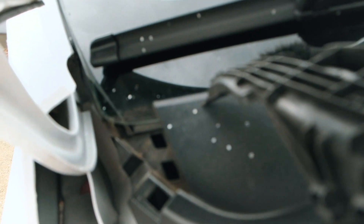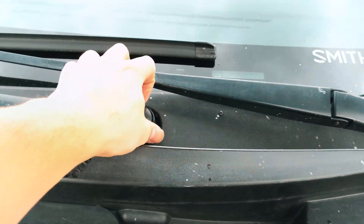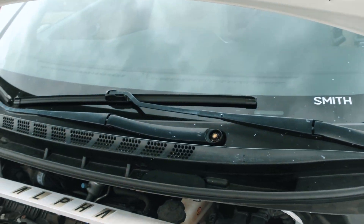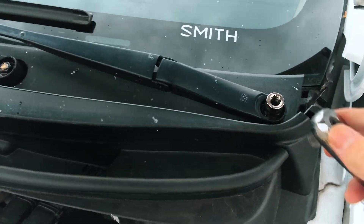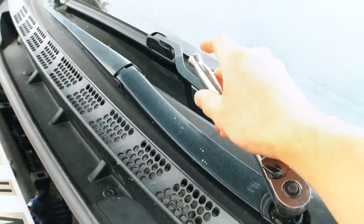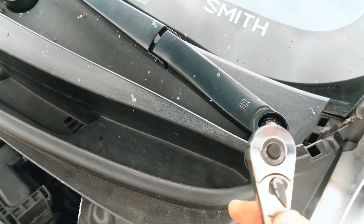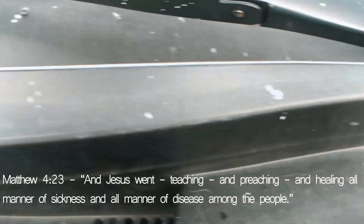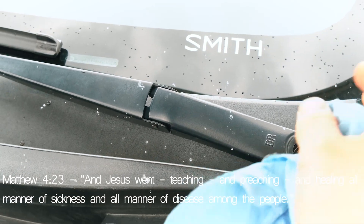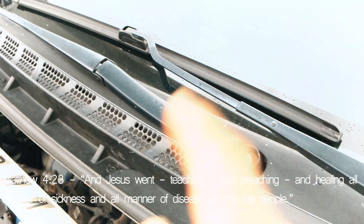On either side, you're going to move these little clips and follow where the seam is. Then you're going to want to remove your grommets here, which cover the nuts for your windshield wiper — just pop those out. You're going to use a 14 millimeter. This is only 25 foot-pounds, that's why I'm using a ratchet for it; otherwise you'd want a use a breaker bar. They indicate passenger and driver so you don't get mixed up. Just pop these off — push down and they come off, and the spring system is already releasing. That spring keeps it tight against the windshield when you're washing. Go ahead and remove both of these.